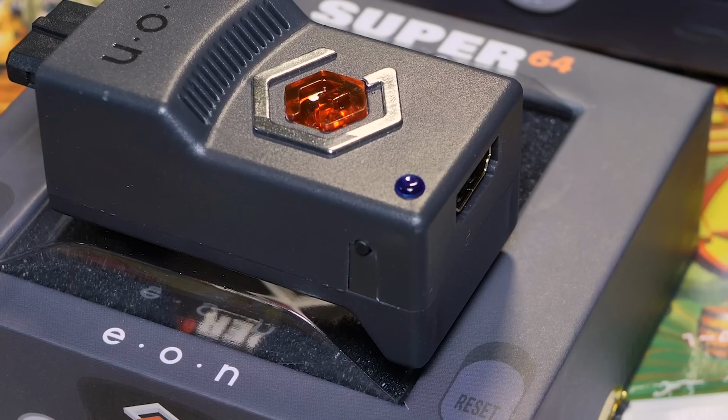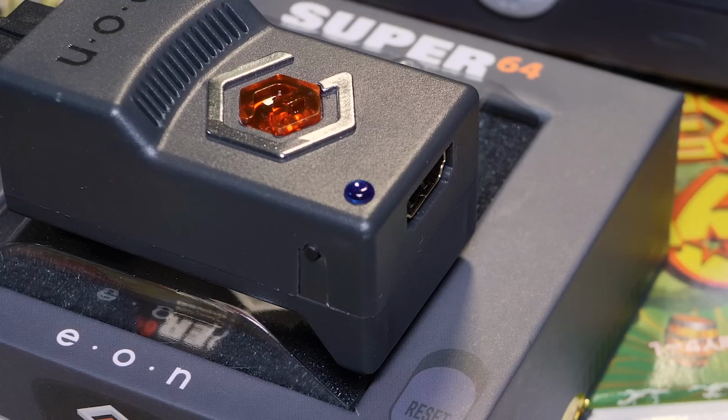And one of the issues is that you have that HDMI output. You can use another scaler to scale 480p up to, say, 1080p, but the traditional ones, like the FrameMeister, don't actually work with it. With its HDMI input, obviously the OSSC isn't designed to do this with HDMI. Some receivers will do it, but it adds input latency, so you really need to make sure that your display can handle 480p well for this to look good.